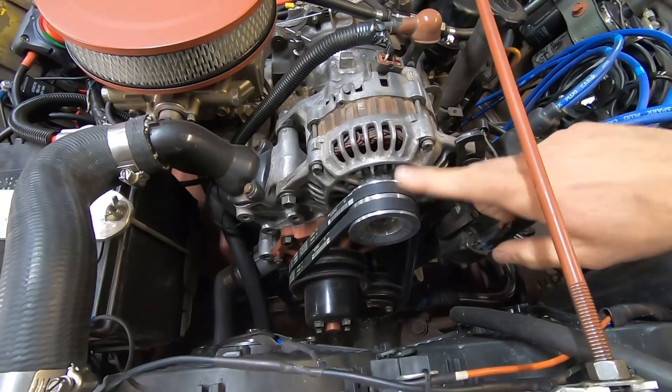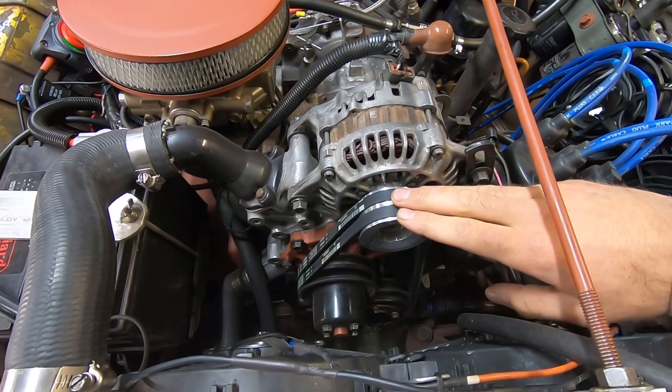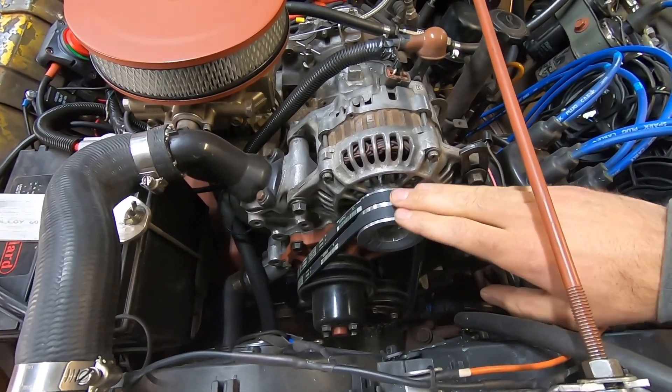I have added a double belt pulley, which does help from slipping — because if your belt is slipping under load, then it's not charging. Another thing to take into consideration is the RPM ratings for your alternator. Think about the speeds your engine is normally running; it has to be able to charge efficiently at that speed. A lot of those one-wire alternators don't charge very well at really low RPM, so if you have an L head and you're running slow trails, keep an eye on your voltage. The way I'm going to deal with all the extra draw I have on my system is with an upgraded alternator.